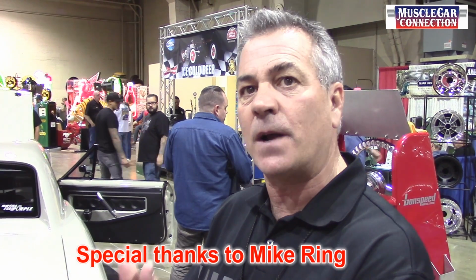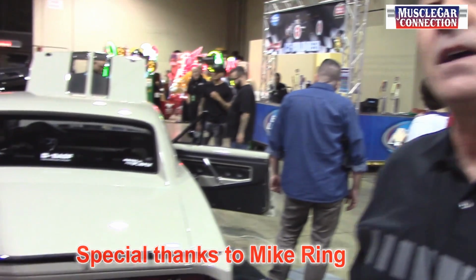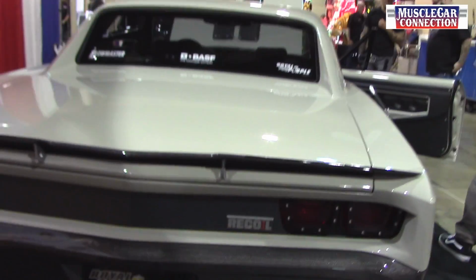So you almost have to compensate for the amount of paint on the door and on the hinge when they go together. When you first mock that up, you have to compensate for the layers of paint and primer that move that door back. So I think it's just time that you realize how much you have to do with that.